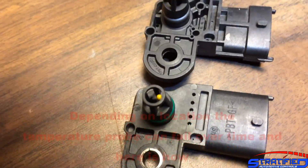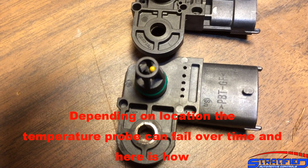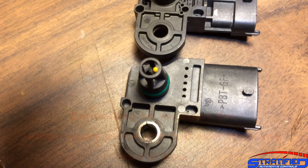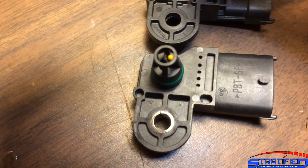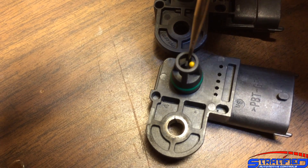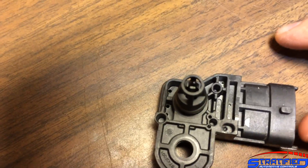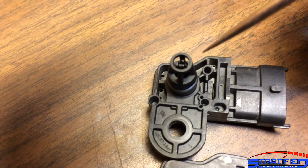What you see here is a Bosch 3.5 bar T-map sensor that we used to upgrade our Focus ST to reading 3.5 bar before the throttle body. I've had an interesting failure where the temperature probe has failed on this sensor — you can see it's moving around very easily. We compared it to the OEM sensor, which is quite a bit different — this is the OEM sensor that sits in the charge piping on the Focus ST.